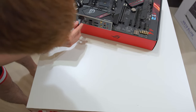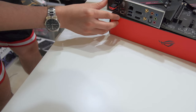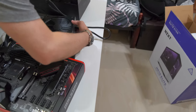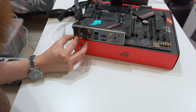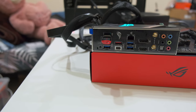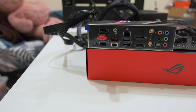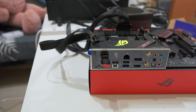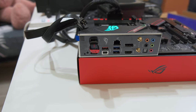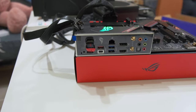So let's do the BIOS flashback. Insert the USB into the BIOS flashback port, and then power it on — power the PSU. Press the BIOS flashback button for 3 seconds. Now you can see it's blinking. When it stops blinking, the BIOS flashback is finished. If you haven't seen my video on BIOS flashback, check it out — I'll put the link in the description below or in the popup on the top right corner.